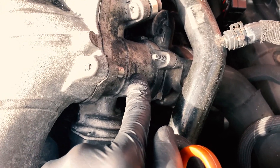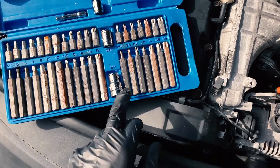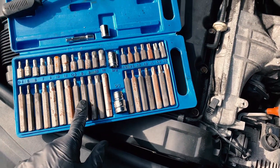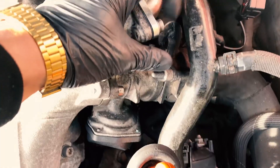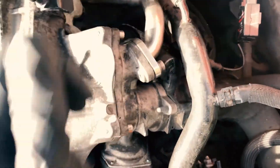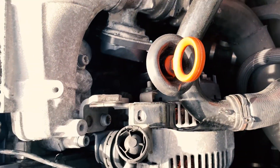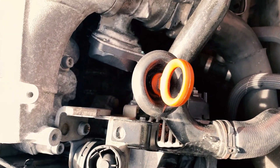In order to remove the EGR valve, we'll mainly be using a Torx T30 bit, and a star number 8 — probably number 10 — for the big bolts on the EGR valve. The others are on the EGR pipe, so first things first we're going to undo the bolts on this coolant pipe.